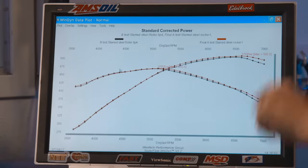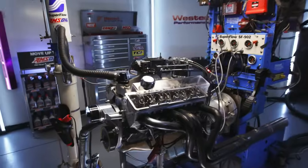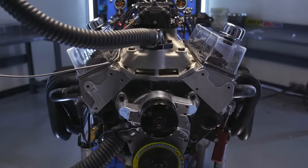The results show the stock stamped steel rocker arm actually made more power from 5,000 RPM on up, and our theory is that the smaller stud is flopping around — more and more deflection as engine speed climbs. That said, it's still a fair test on the roller tip because you can't buy it for a 7/16 stud, so that's what you deal with. This tells you that even if you have a 300 horsepower 350, that roller tip rocker arm isn't doing anything for you power-wise. The only point is that Comp Cams sells these not claiming power gains but improved ball and stem tip wear — and that's certainly a possibility since there's no rubbing. Now let's throw the real roller rockers on.